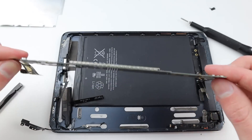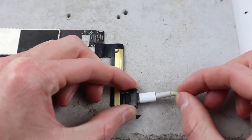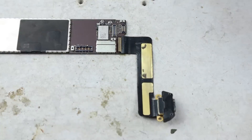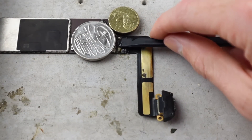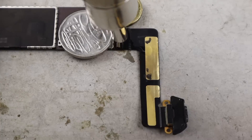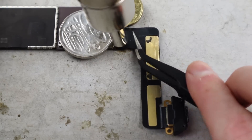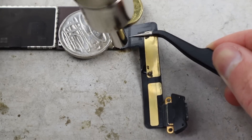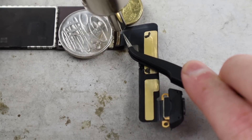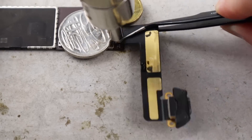With that removed, we can look at fixing up the dock connector, and for that I'm going to need a solder rework station. You can see just how loose the connection is — while it is still charging and syncing with iTunes, I run the risk of it failing after just a few charges. So I applied some flux to the connector and started heating with my solder rework station. I'm completely new at this sort of micro-soldering, although I have done many soldering jobs in the past. All I need to do is really heat up the area and apply as little pressure as possible when removing it, so I don't rip up any solder pads on the logic board. This took a couple of minutes, probably because I didn't wait for my rework station to heat up and it's not a very expensive one, so it's probably not very accurate temperature-wise. With enough heat and some slight pressure, it's removed from the board.